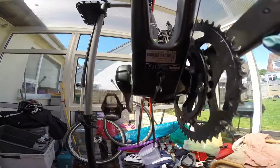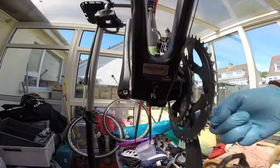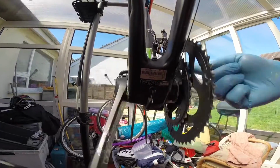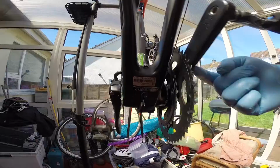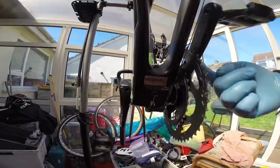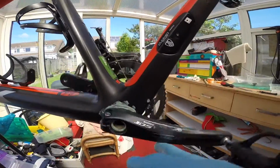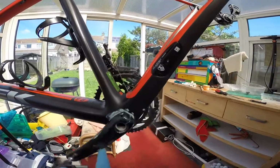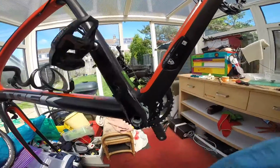Now that is the inner sleeve rotating. Now that will disappear, but what I'll probably do is take it out and just give it a little bit more grease. As you're aware, movement will cause anything to wear without a bit of lubrication. So this is literally just pushed on at the end. Now what you'll find is when I take this off, you'll see where the rubbing was.